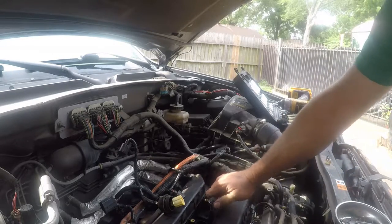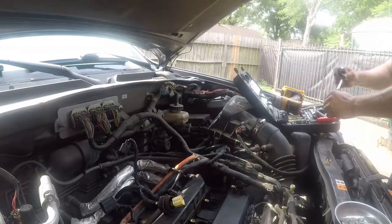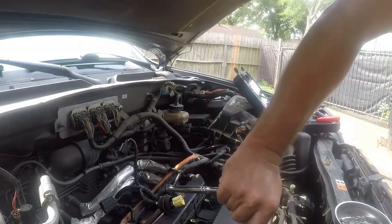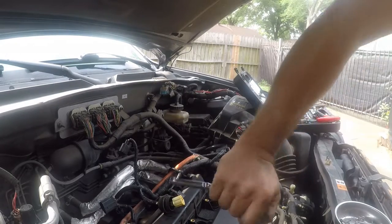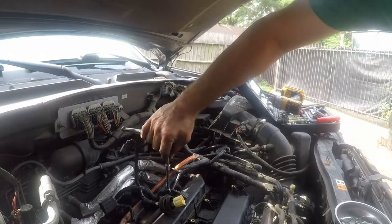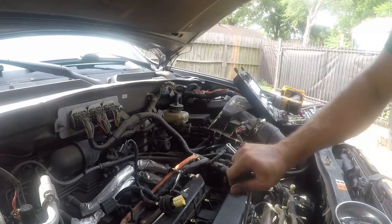I'm just going to snug them. Generally speaking, you can put about 9 foot-pounds with your wrist. So you'll notice I'm holding it here. I'm not holding it way out here where I've got a lot of leverage. And I'm just twisting my wrist. And I am using a cross pattern from the center out to try and even it out. I mean, it is a piece of plastic, so it is somewhat flexible.